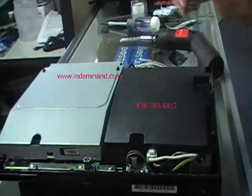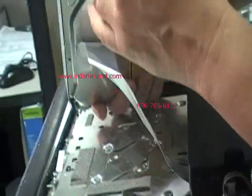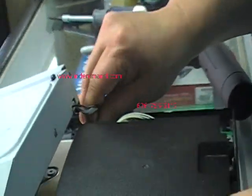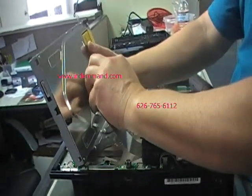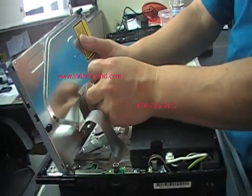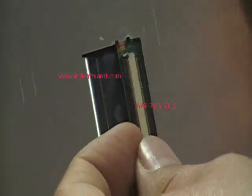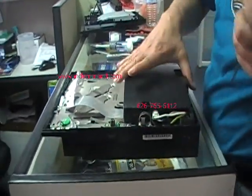To take out the Blu-ray, just lift it up. First remove the connector on the motherboard — tilt it away from you, don't pull it. Then remove any tape covering the connector; some units have tape, some don't. Push the latch up towards you, and once that's done you should be able to slide out the connector. Put the latch back down so it doesn't damage the connector. Put it aside — the drive is now out.